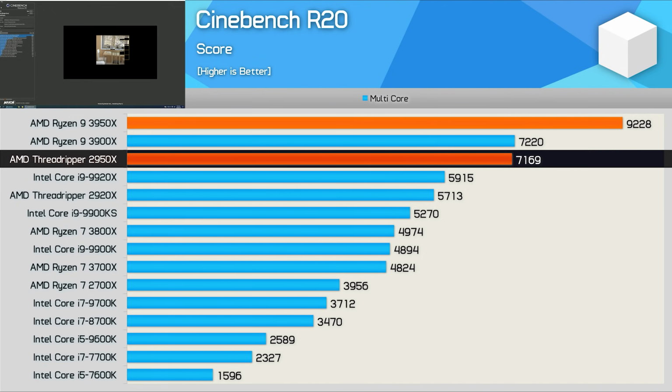While I suspect 2950X owners will be holding out for 3rd gen Threadripper, those of you thinking about snapping up a 2nd gen 16-core processor will want to get it for $500 or less, given the 3950X is almost 30% faster. Of course, the 2950X offers more PCI Express lanes, but if you can make do with an X570 board, then the 3950X will be the better option.